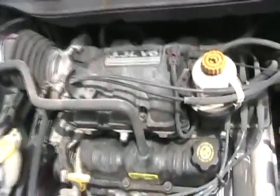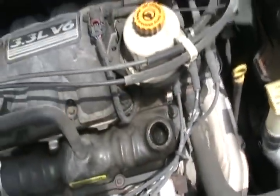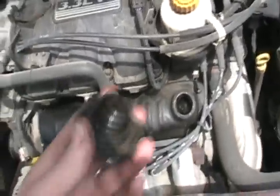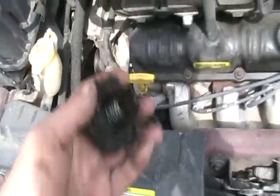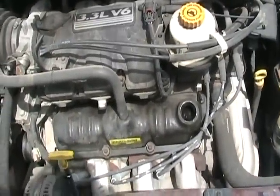Every car has an oil cap. The two coolest parts of your engine when it's running are the top of the oil cap and the top of your dipstick tube, so condensation forms on there. Where does the moisture come from? For every gallon of gas you burn, or pretty much any fuel, you get 7 tenths of a gallon back as water vapor.